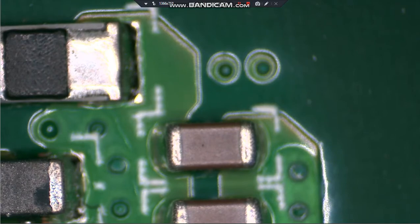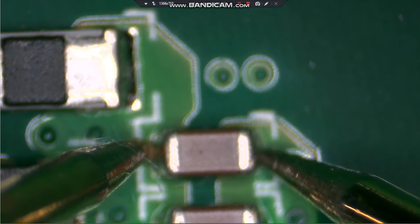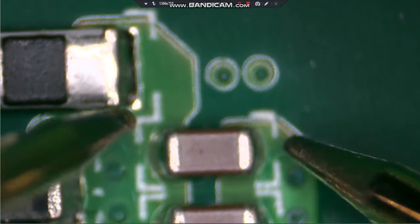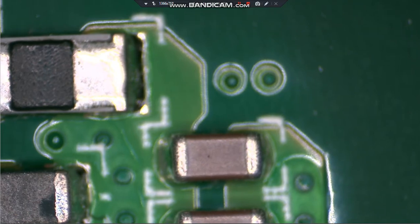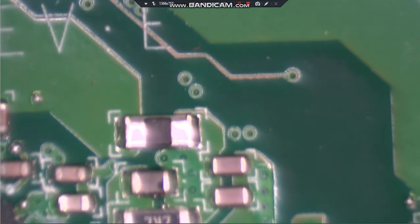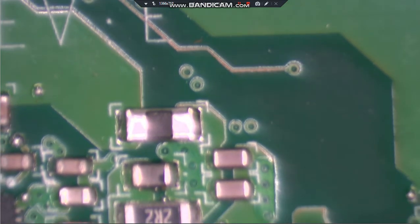Being left in so long with one of those blown - let's find out if one of those is blown. Put it on resistance check and we'll check across it. Yep, we definitely have one of those two shorted. So let's go ahead and take care of those so we can turn this back on. Unplug it - no need to blow the other fuse we just put in.